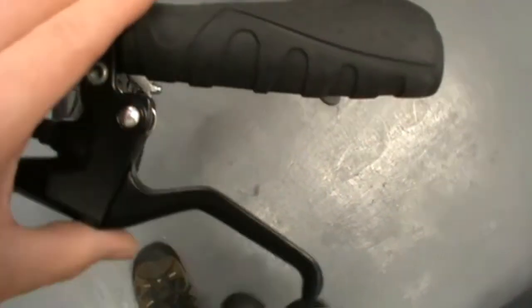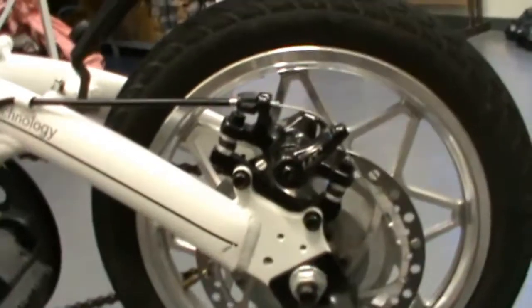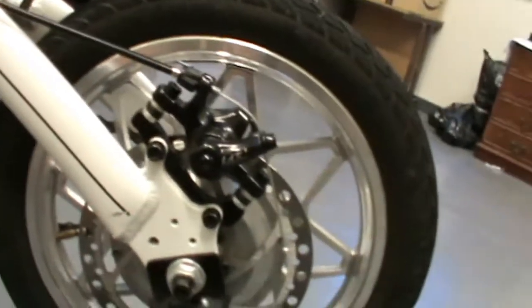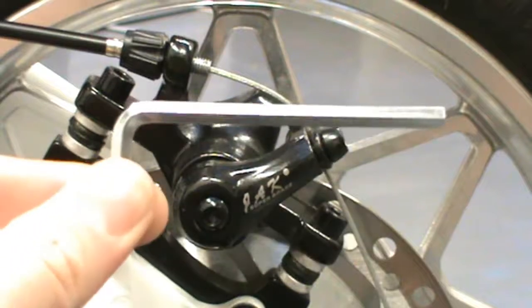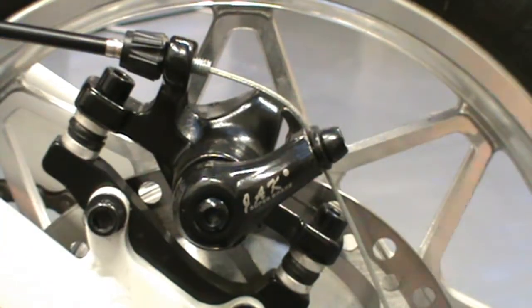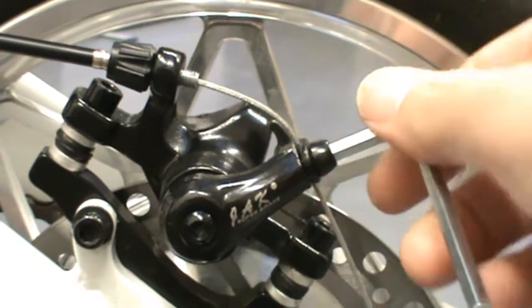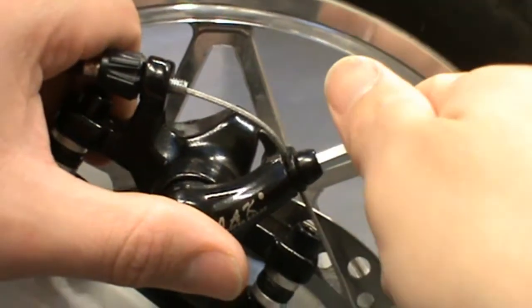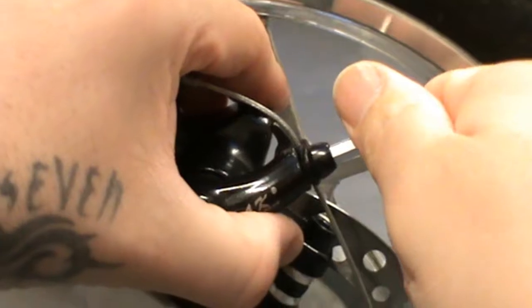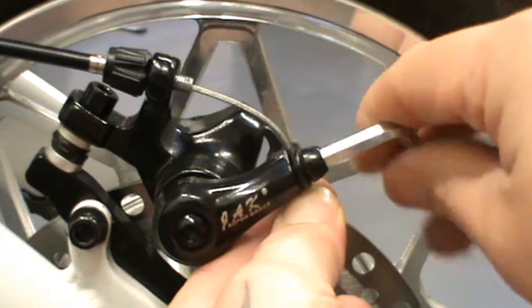In this particular instance, I didn't need to adjust the cable tension on the caliper. But just for the sake of this video, I'm going to show you how to adjust the cable tension anyway. Cable tension is simple — just grab a 5mm allen key, pop it into that allen key nut, hold the caliper supported, and open that nut. Don't open it all the way, because then you can grab the cable and stop it actually flinging off.